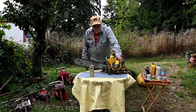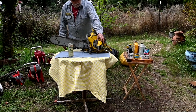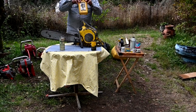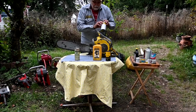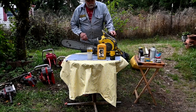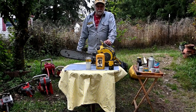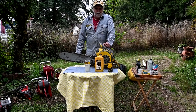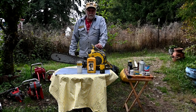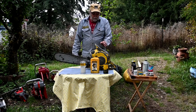This can here would have been a very early two-stroke mix, probably about a 20 to 1 ratio at that time. McCulloch eventually went to 40 to 1 — these are all 40 to 1. Even though I used McCulloch oil when I could get it, I never really ran them at 40 to 1. I always ran mid-sized saws and up at 32 to 1, and the small saws at 20 to 1, using really good oils. I never had any carbon problems or mechanical problems with them. Most of them are still on the job after all these years.